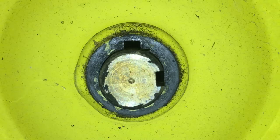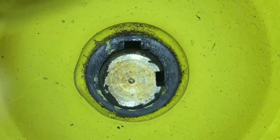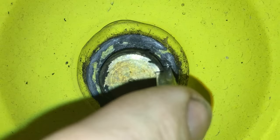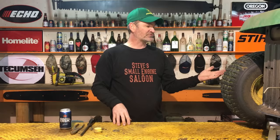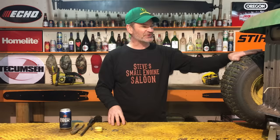All you've got to do is spin your tire around. You see the axle right there has a little half-square, and your wheel has a little half-square. You just line those up so it's a full square right there. Take that key and just put it right in like this — slide it in. Now it doesn't spin around anymore. Now it's locked to your axle, and that's what you want. Button it all back up with your washer, your E-clip, and your little dust cap. I'm not going to bore you guys with how to take your wheel off and back on again, because if you're running into this issue, it's because you took your tire off and you already know how to do that. So there you go — button it all back up. Now you can go get your grass cut.